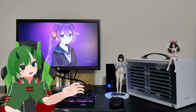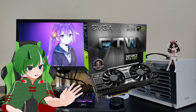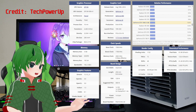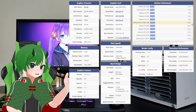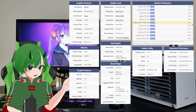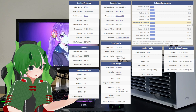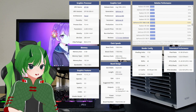Let's get down to business. We'll start off with everyone's favorite Half-Blood Prince of a GPU, the GTX 1060 3GB. I made a standalone video on this card before. To remind everyone: this card launched August 2016, a little after the full-fledged 1060, and everyone had problems because it was a cut-down version in almost every aspect. At stock, base clocks are 1506MHz, boosting up to 1708MHz, with a memory clock of 2002MHz. It has 1152 CUDA cores, and most 3GB variants use just a 6-pin power connector — it's a pretty power-efficient card.